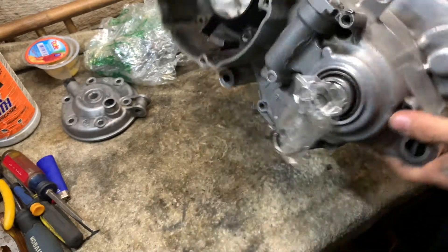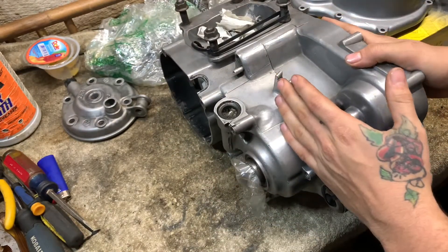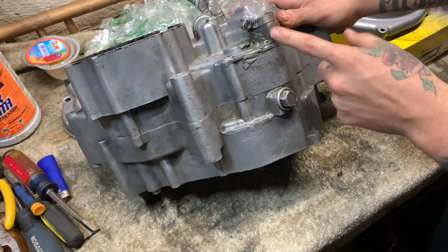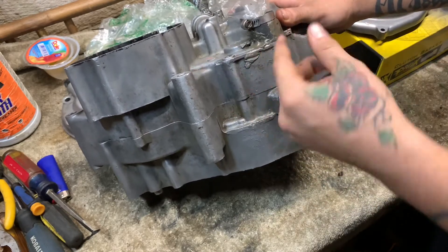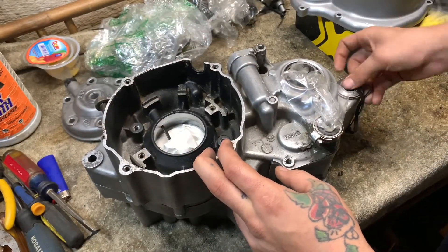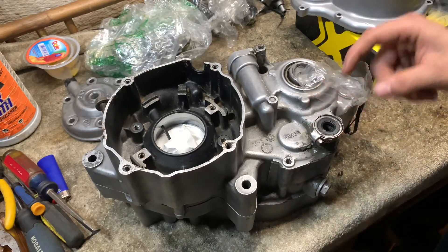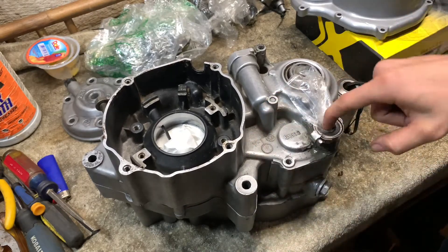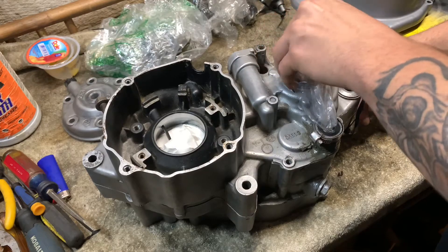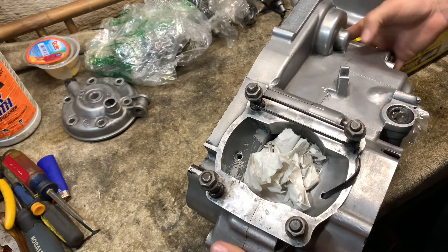Here's the other side — nothing really to it. The reason I bought this side of the case is because it has JB weld right here, which I don't like. It doesn't leak — whoever did it did a pretty good job — I put water on the opposite side and held it there for 10-20 minutes and nothing went through. But this is where the shifter shaft goes in, and over time while shifting, this will get loose and that's another problem I'd have to deal with. So I bought the spare side so I can replace it when it does go.